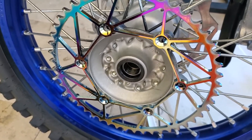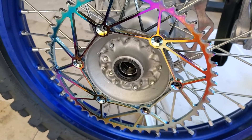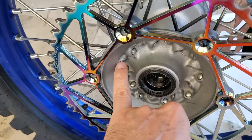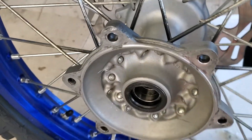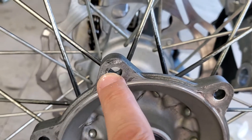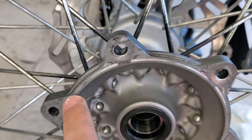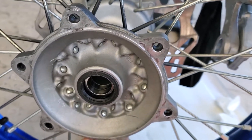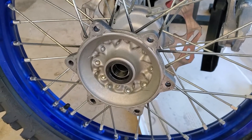This could have been very damaging or even gotten me badly injured. Now I've got to go inspect everything and make sure I didn't crack anything. You can see it marred some areas where the bolts flew out and caught the hub. You also have to check whether the bolt holes got oblonged — and mine did, mildly. You can feel a little ridge where things got smashed by the torque of the 450. It was so loose it was probably a hair away from fracturing the whole hub.